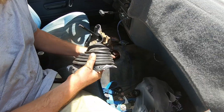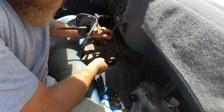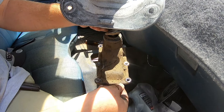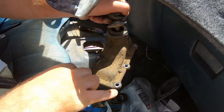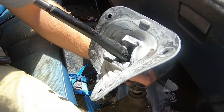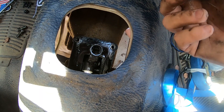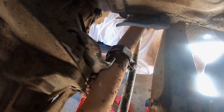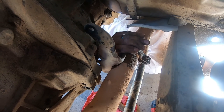Be careful with this thing because it's probably fragile. It pulls right out — kind of looks like that. There are three on each side: two from inside the cab, and you've got to be underneath the truck for the third one. There's a gasket too, so be careful — if it's ripped or anything you can replace it. There's a little bracket that holds the exhaust up; make sure you slide that off and the bracket piece comes out.